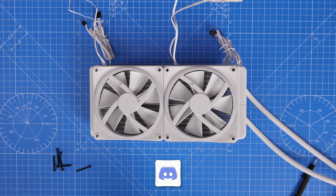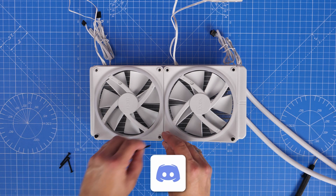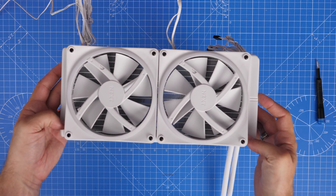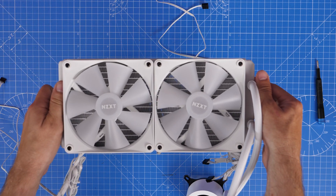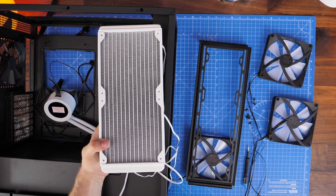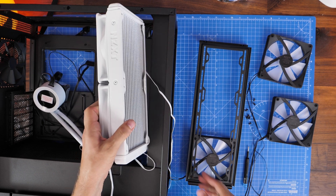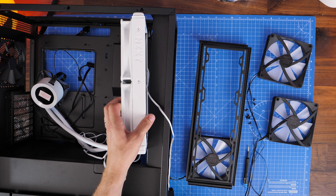Another stupid oversight that you probably wouldn't make, but something to think about and plan out. It's an interesting concept — this is also a demonstration of why it makes sense to plan out your build even before you've purchased the parts, to make sure everything fits and is going to work logically. This is a 280mm radiator that I'm fitting in a case that could actually take a 360mm both on the front and the top, so 360 would be preferable.